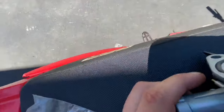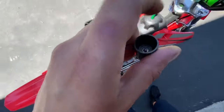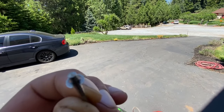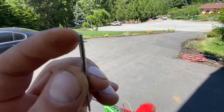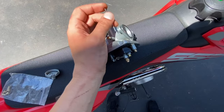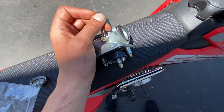There is also a third jet. Unscrew the top — there will be a spring inside — then pull your slide out. This is called your needle jet, and it has little grooves with a clip that holds it in place. When you adjust the clip down, it actually lifts the jet up higher, and this jet sits on top of your main jet inside the carburetor. When the clip is lower, the needle is raised, allowing more fuel to flow through it. At full throttle it opens wide.